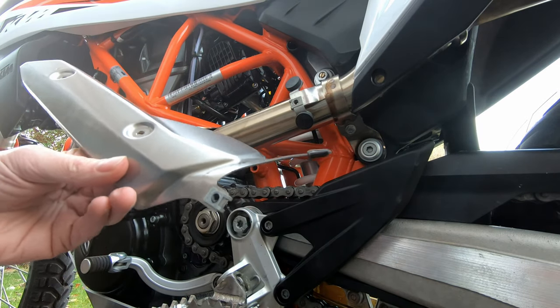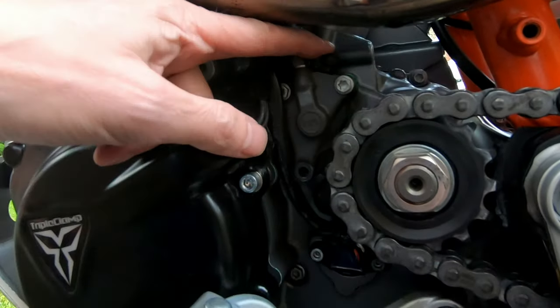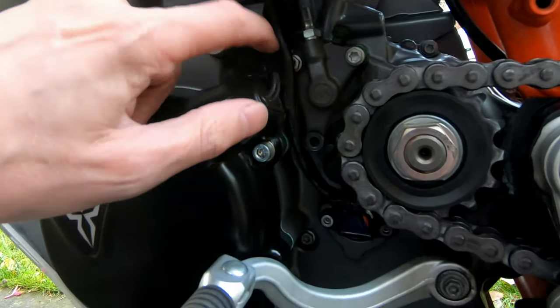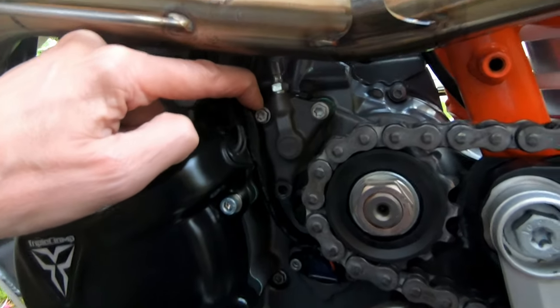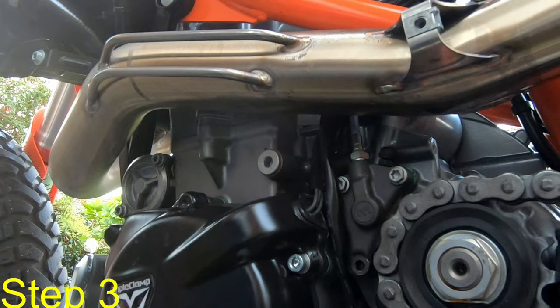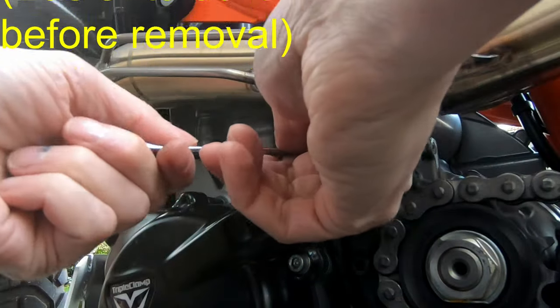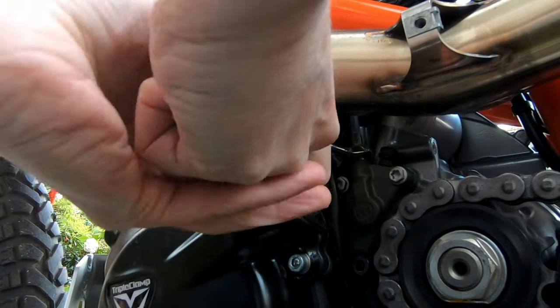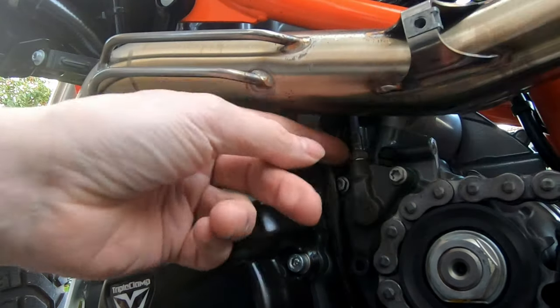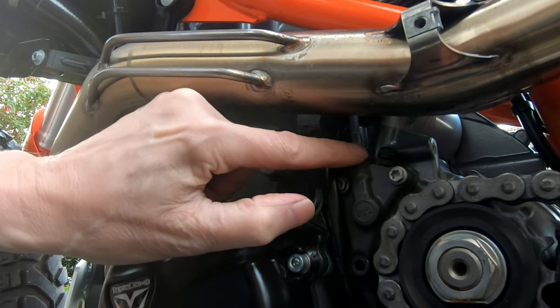At this point I really had to go and get my glasses — I didn't see that one. Yeah, that just makes it easier to get at that. So that's a bleed nipple, and the bolts — there's the old slave cylinder. That would appear to be 11mm, I'm just going to loosen that, simply because it's easy to loosen it when it's fixed.